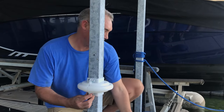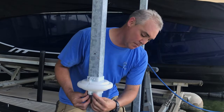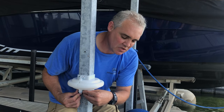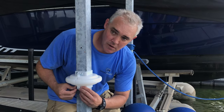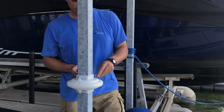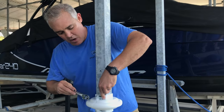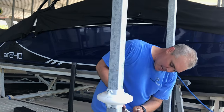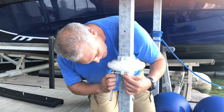One of the great things about these is you don't have to drill into the post. As you can see where those post cushions were, you had to drill into the post to mount those. A lot of times when boats are coming in and just skid across those post cushions, it'll rip those bolts or screws out. So on the WAM guards, you don't have that problem. As the WAM guards rotate and spin and deflect your boat, I just go around and get these all evenly tight, then go back and really tighten them down.